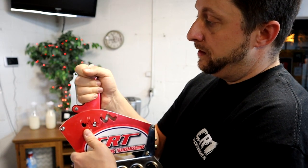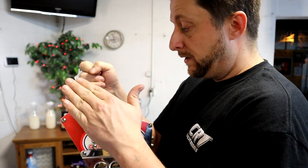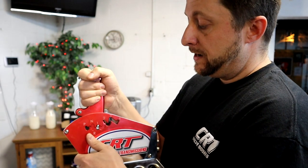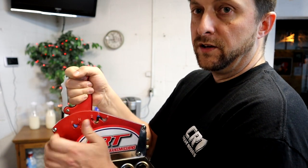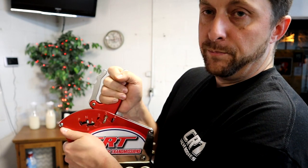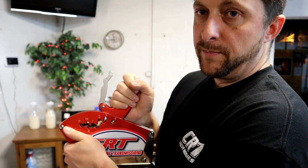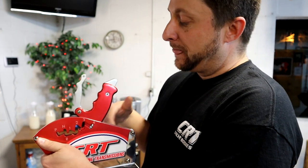At the staging lines, staged at the tree, we'll have the trans brake button mashed and get on the gas. The engine will rev as high as we want but the truck won't move as long as the trans brake is held in first gear. As soon as I let go of the button the truck launches. Then to go to second we just grab it — second gear. Pull back to third, then ease up and pull straight back to fourth. Hopefully we're hauling some major ass at that point.